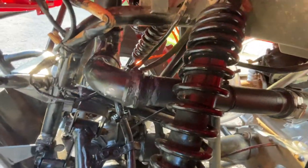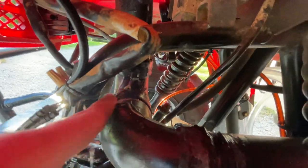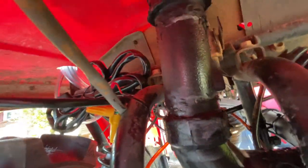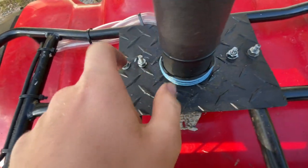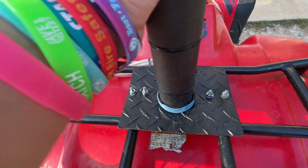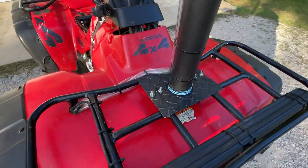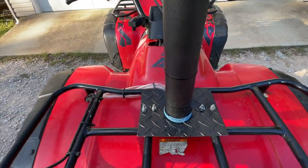Next it comes into either a street 90 or 45-degree fitting — either probably works the same — into a short piece of one-and-a-half inch up to a 90, and then it goes straight up into the converter. The bottom part of the converter sits on the bottom side of the plastics and the top part sits on the top. My granddad and I worked on the snorkel bracket together — u-bolts hold it, and I cut approximately a two-and-a-quarter inch hole for the snorkel. I'd recommend two-and-a-quarter as your best bet.